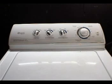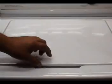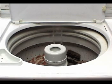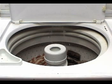This is the way the washer is supposed to fill. Set the water temperature switch on warm and turn the timer on. The washer should start filling with warm water. If it's filling only with hot water, only cold water, or the water just trickles in and it takes forever to fill, you will need to check the parts in this chapter until you find the problem.